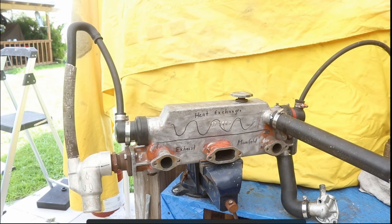When the coolant is mixed with salt water, the symptom is that in the reservoir tank you will see that the color of the coolant changes, and you will see a lot of calcium deposits in the expansion tank cap. In the full video about cooling systems, this is explained in more detail.